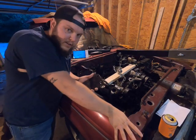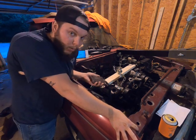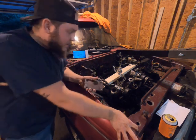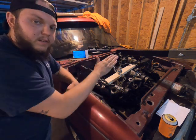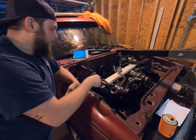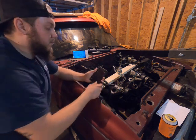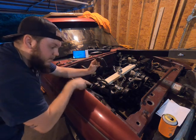So we got the trans mount in, now it's time to make our engine mount. I got these plates that I cut out and made some holes. I'm going to jack the engine up — I got a board laid across the valve covers as a point of reference for even keel side to side. We're going to put both plates on and start taking measurements once we get it level, so we know what to cut our flat stock for. Basically, the plate goes up like this, two pieces of flat stock come out, welded here and welded to the frame somewhere underneath.